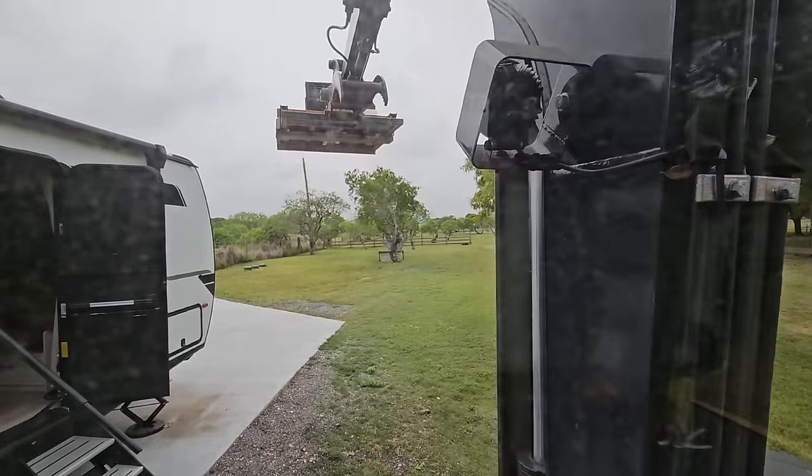So I'm gonna have to figure out wire routing, because I'll likely have to get these wires to come into this space so they can connect right here, because it's kind of backwards from the system we removed. The return air was right here, so all the wires routed to this side right here, whereas this one has a return air right here, so everything's kind of reversed. I think we have some room to squeeze. Yeah, we definitely have room to put the stuff up here, and then we'll have to seal it all off.